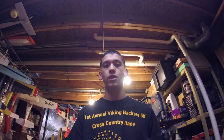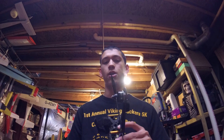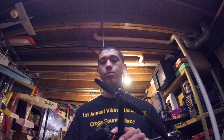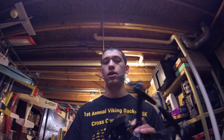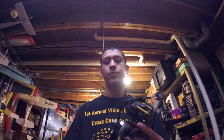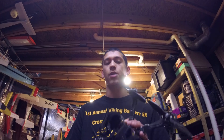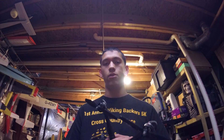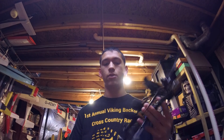Now that you've seen how this thing flies, I'll talk a little bit about what it's like behind the sticks. As far as power is concerned, these new F60 Pros are a little bit more powerful than the old F60s, and they also draw a few more amps. On the DAL 6040 bi-blades, I'm pulling around 90 amps compared to around 85 on the old motors — I think that's a fair trade-off. Where these motors really shine is responsiveness. I had to lower my P-value on pitch and roll by 10 to get the feel I wanted, so these motors are definitely way more responsive than the old ones.